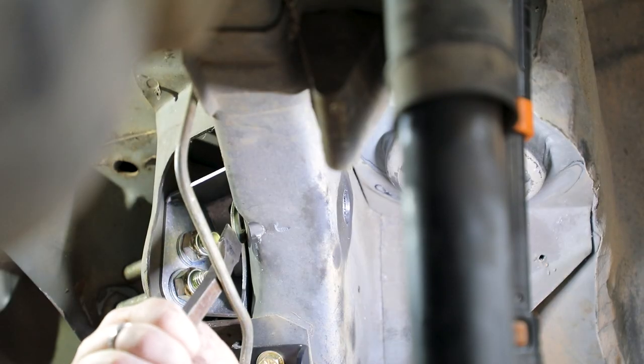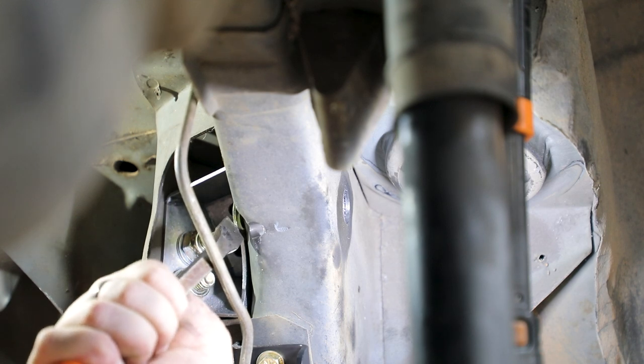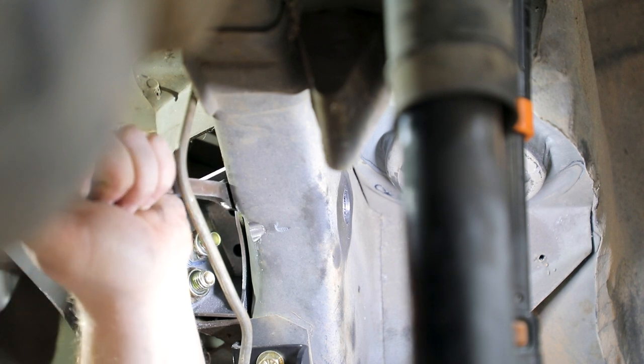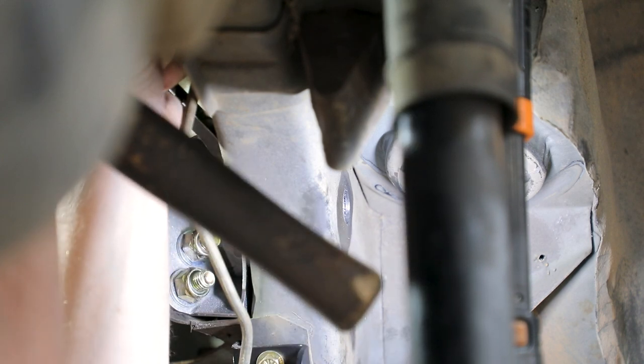Place the provided 7/16-20 by 3/4 inch hex head bolt and washer through the frame rail hole on the swivel link brace weld assembly side. Make sure the washers you added earlier are in the correct location to allow the bolt to pass through the washers and into the frame rail.